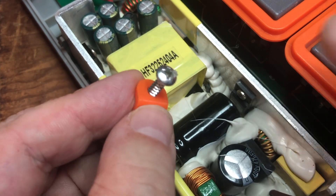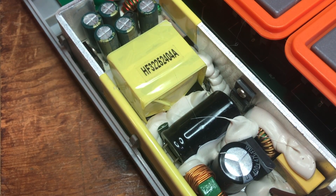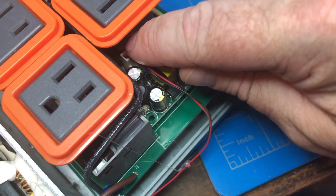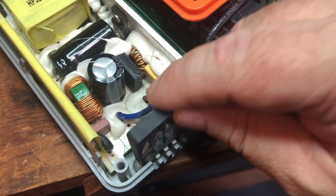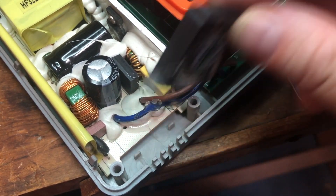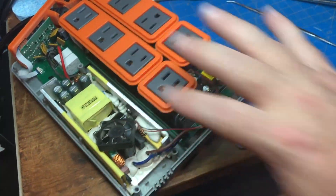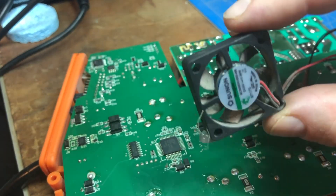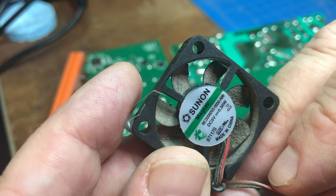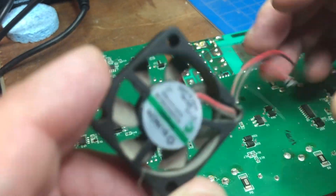I did get that nailed out. I don't know why they put glue in these screws — that was kind of a mean thing to do. I guess they don't want you fixing these things. There were two of them. The last thing you may need to be concerned with is the fan, which connects just over here — you'll have to unplug that. This board looks like it was glued to the bottom case at some point but that's come off, so it's just free-floating. I'll take this whole thing off together and lift the board out. The fan is quite dirty so I'm going to clean it up and hook up five volts to see if it's working.